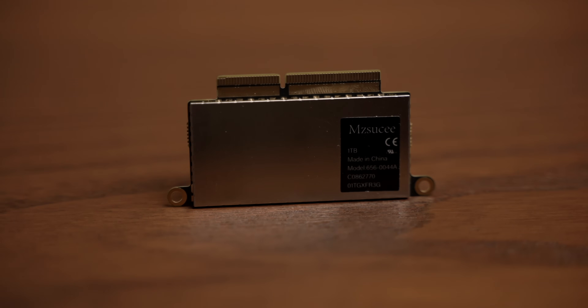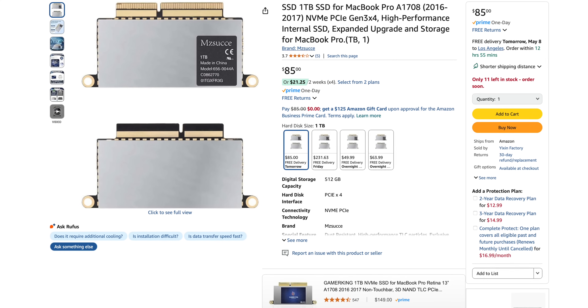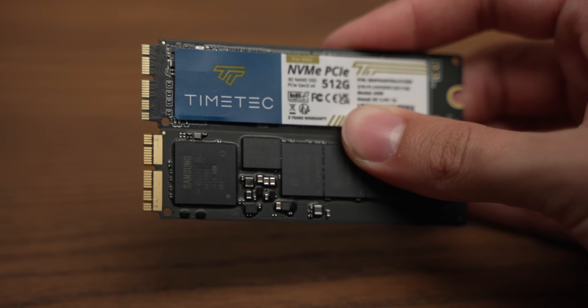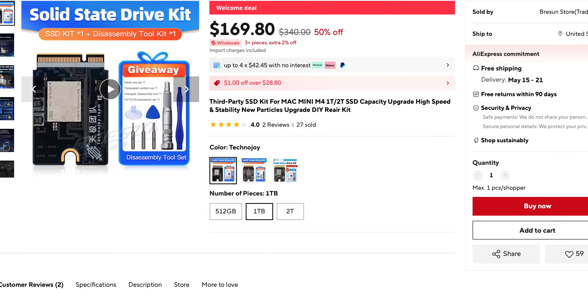When you transfer a large file, those NAND chips are going to heat up very quickly and absolutely tank the transfer speeds. Yes, it is a 1TB SSD — it was not a complete fake — and yes, it is $35 less expensive than an Apple original, but you do pay the price pretty significantly. This needs to be said across the board: in a recent video I tested another type of SSD for the older style NVMe MacBooks, and that was also slower and lower quality. I would definitely be careful about using these third-party drives for Apple devices, and that applies to the new M4 stuff as well — the new Mac mini, the Mac Studio. Buy from reputable sellers.